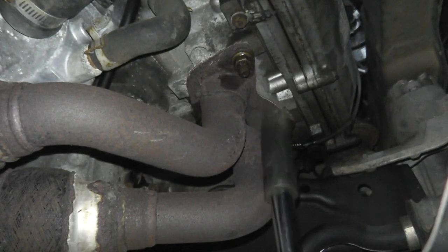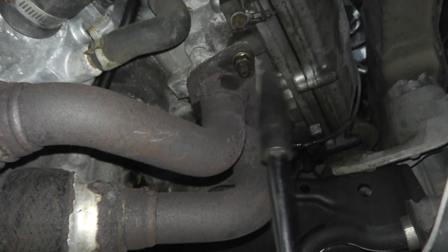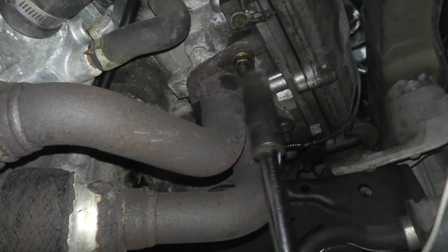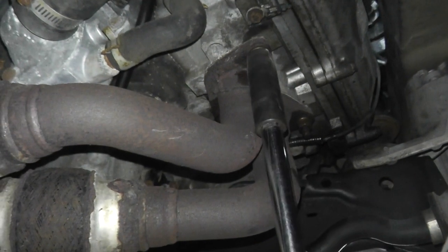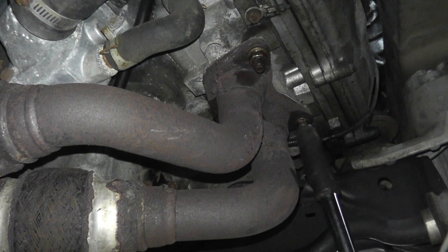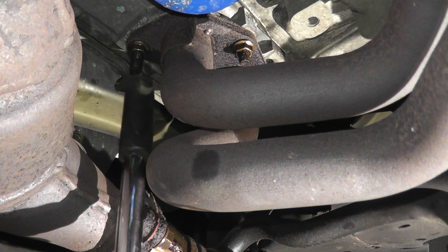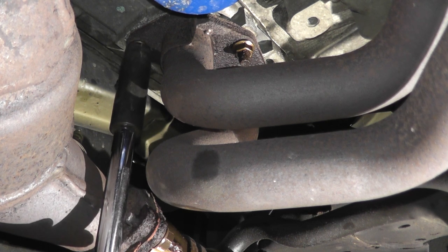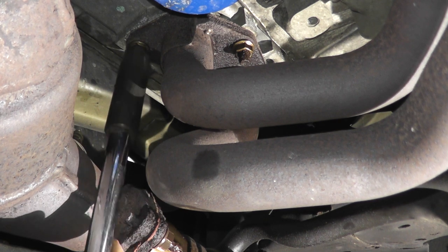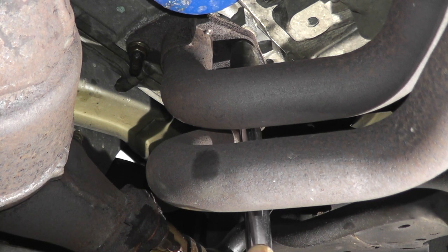This is the driver's side cylinder head, and I'm just going to back these off. This is a 14-millimeter fastener — and the breaker bar makes it very, very easy. This is the passenger side. As you can see, I take it very, very slowly because I don't want to snap anything. Just ease into it.